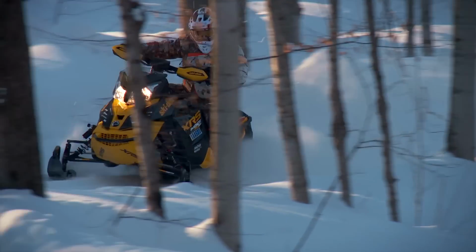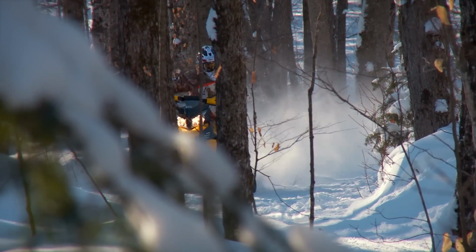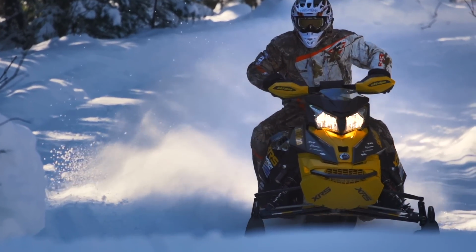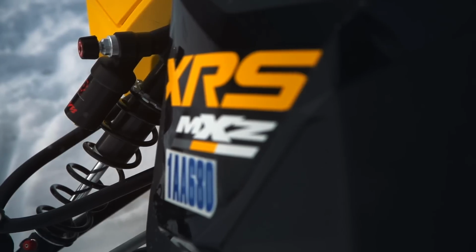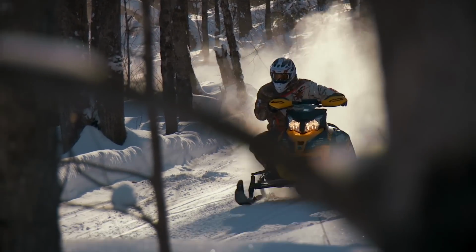However, the XS chassis did have some minor drawbacks. The front suspension on the XS was not the problem itself. The pieces were good, however the geometry that was used was not as compliant as we knew it could be. The heavier than its competition steering on the XP and XS models was noticeable, and while the RAS front suspension did a great job of staying on the ground and cutting an aggressive line, it was just too heavy feeling at the bars, and the geometry, linked with the incredibly forward riding position and low center of gravity, made for inside ski lift and unpredictability in the steering the further you moved into the travel.